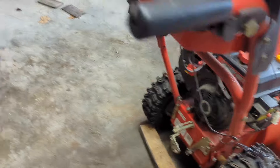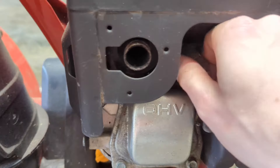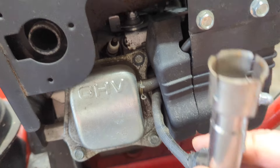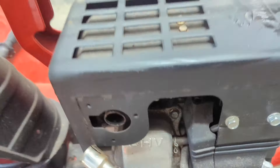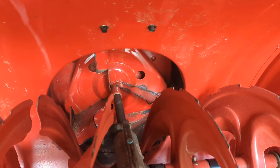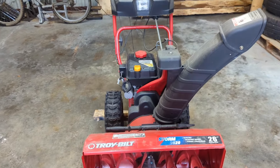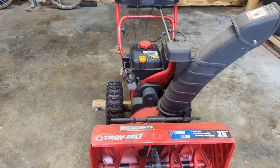This is an important tip: I have to reach inside the auger - never ever do that unless you pull the spark plug. You can see the spark plug there with the wire right there. Now the engine can't start if you reach in there. I know it sounds stupid, but there's always a situation where you want to make sure you're as safe as possible. I did tighten up the drain bolt off camera with the wrench so it's not just finger tight.